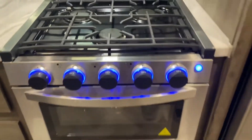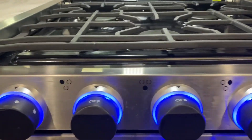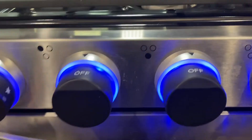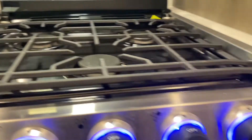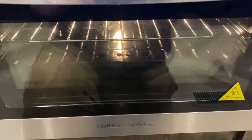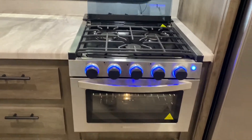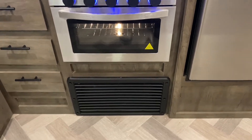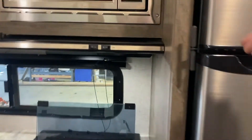There is decorative blue LED lighting on the stove. Each burner as well as the pilot inside the oven has a spark igniter — this handle on the left is the spark igniter and it only turns one direction: clockwise. To light a burner, put it to the high position and spin the igniter to ignite the designated burner. For the pilot you may have to turn it a couple of times to plumb the gas down inside. The black vent below is the air intake for your furnace — don't block that if you're running the furnace.